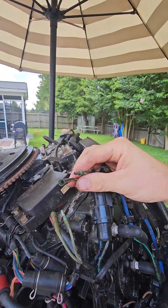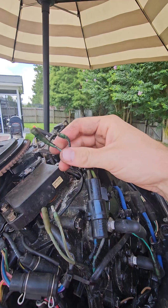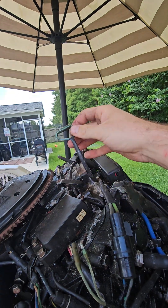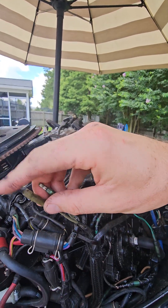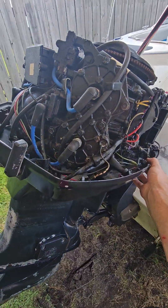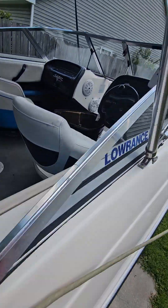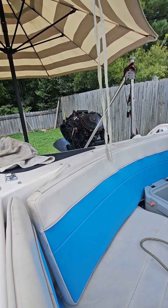Another easy way — if you're stuck on the water and you can't trim up or trim down, simply connect these two wires together that go into this junction box, while these two going back to your sensor are still unplugged. That will easily get you going and at least troubleshoot that switch. Now you can see I got trim up. Just checking it on my console as well — down works fine, up works fine.